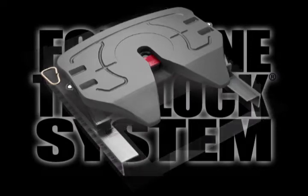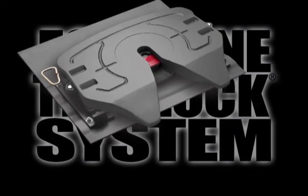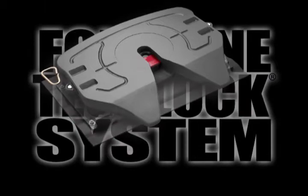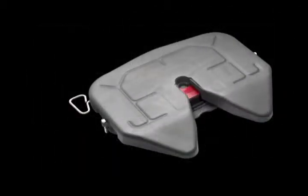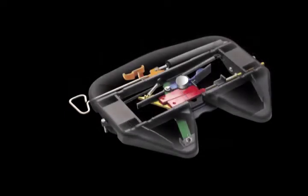In fact, the Fontaine No Slack 2 is the most technologically advanced locking mechanism in the world. In these next few minutes, we will show you the proper coupling, sliding, and uncoupling procedures. Before we begin, let's take a look inside a Fontaine fifth wheel No Slack 2 locking system and see what happens when the trailer kingpin engages the lock.